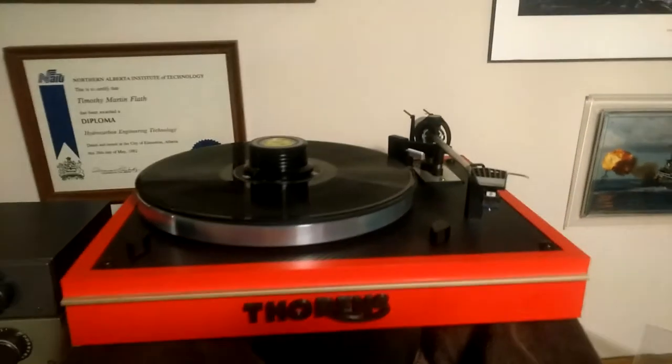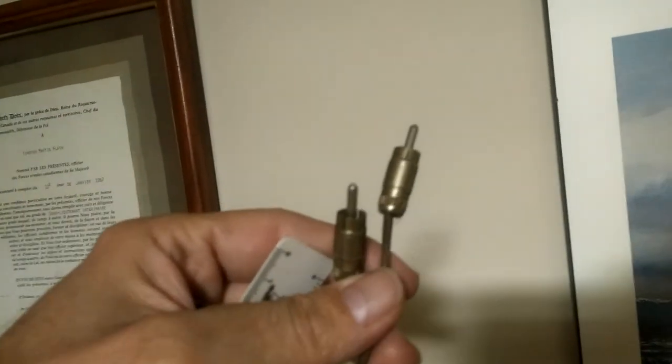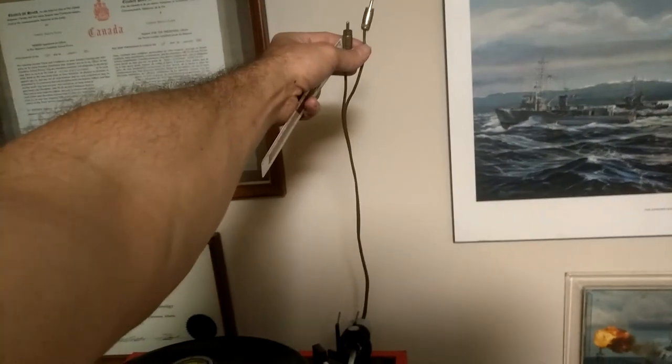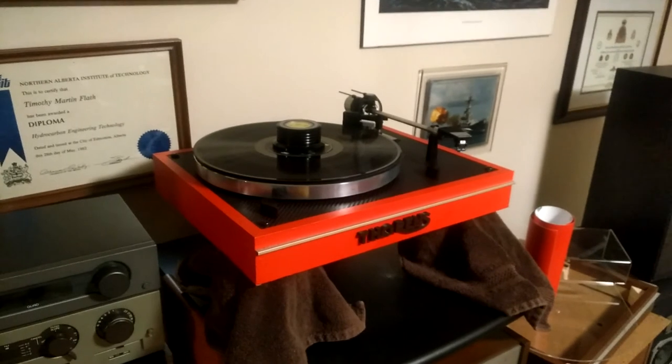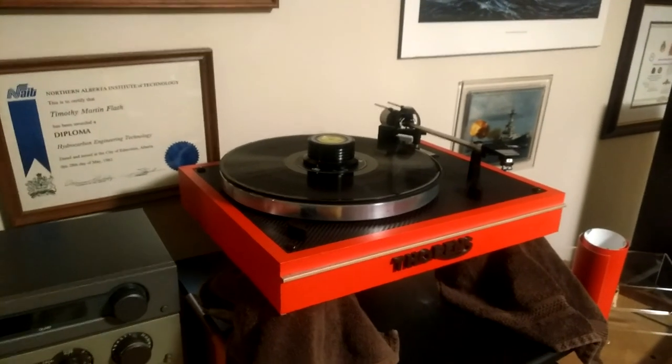One other thing: I'm going to change out the RCA cables. You can see on the turntable these are the remnants — I think they are original, but I don't think the RCA heads are original because they used to use a molded plastic type, and it looks like they've been cut short. One of them is even shorter than the other. Once I solder a new RCA jack onto it and button it all together, I think we have a turntable that is ready to go. Thank you for watching.